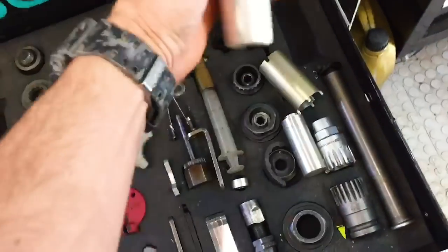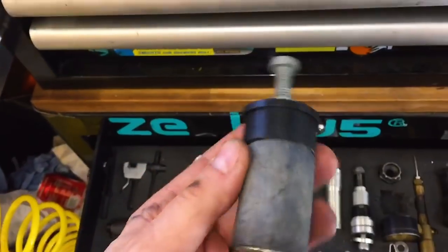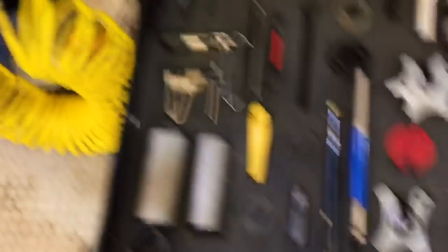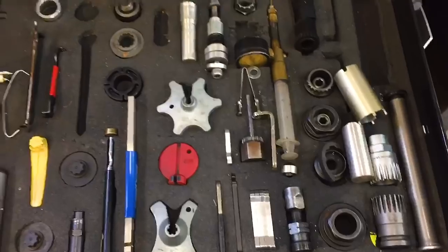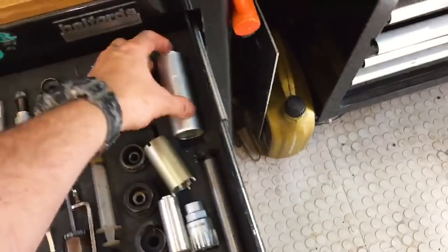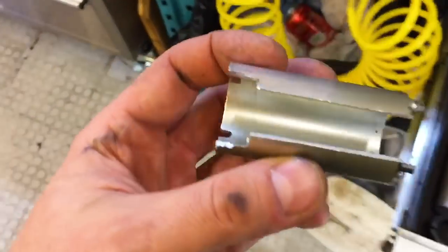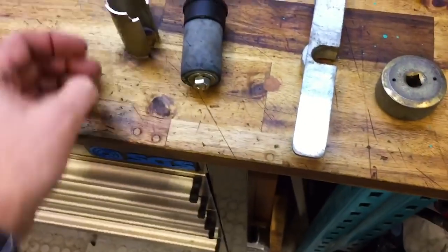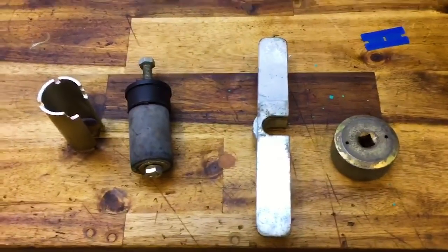You're going to need this tool which holds the sliders in the head shock, if you go that deep down the rabbit hole. You also need some inner tube — you might need to modify and make a tool kind of like this, which I made out of an old slider. Pretty specific bits of kit that are kind of difficult to get hold of sometimes. It's quite specialist. I'm going to throw a link to Full Factory Suspension in the comments underneath this video.